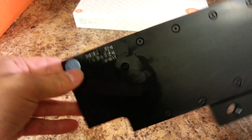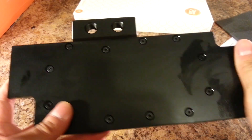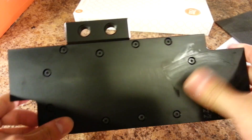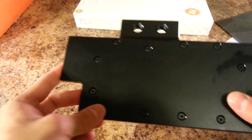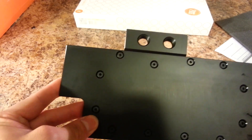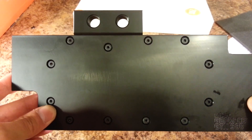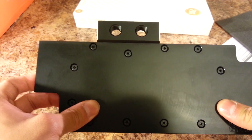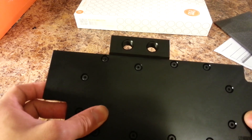The plastic is acetal, and when you get to choose plastics for your water block — excuse the smudge, I've been sweating over the block while reviewing it because I have some lamps next to me emanating a lot of light — you're generally going to come up against acrylic or acetal. Acetal is a plastic with a much better constitution; it's rated for higher temperatures and it's more rigid.